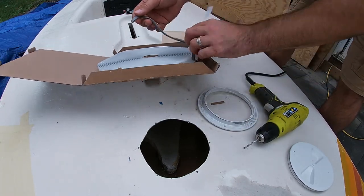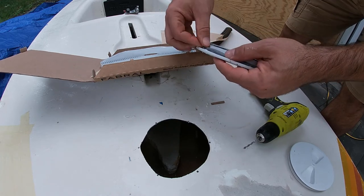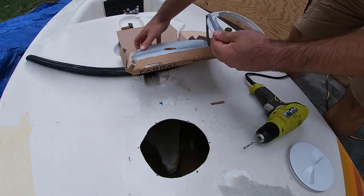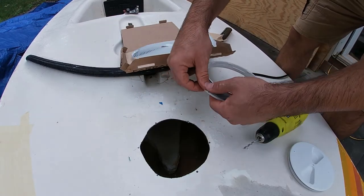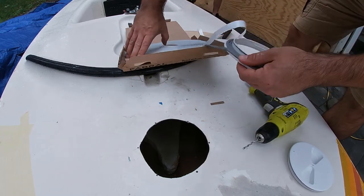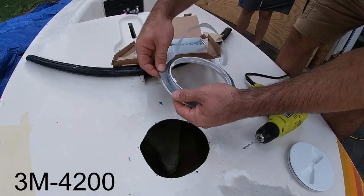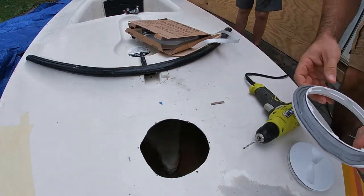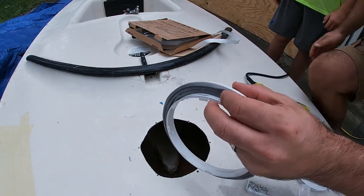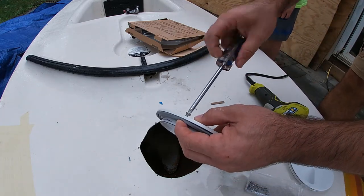I got this for the boat yesterday. It looks a lot like play-doh almost, just a little stiffer, but it stays pliable over time, so it doesn't stiffen up. If you're putting these ports in, you can use something like 3M — the 4000 series, I forget exactly what it's called — it would work well for this. I would not recommend using the 5200 series 3M adhesive, because that's a permanent adhesive and once you do that it's never ever gonna come off. And with something like an inspection port, you're eventually gonna want to take it off.